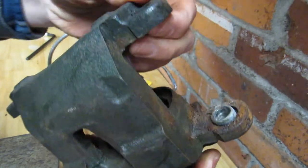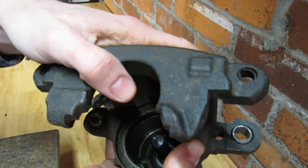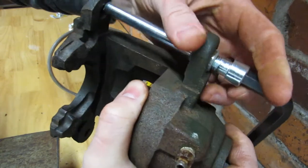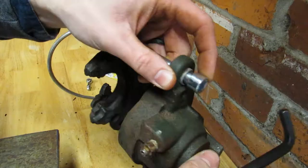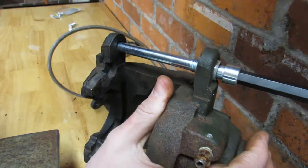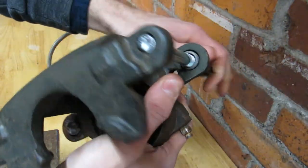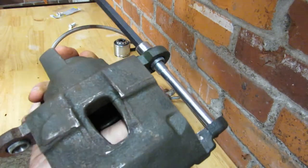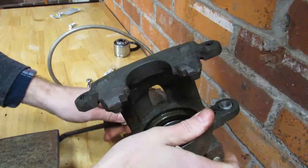The next thing I want to go over are the pins that actually hold these calipers in. These have given me a lot of grief on old cars that are original — not so much on cars that have been swapped. The pins slide in there and allow the caliper to float back and forth. These are just awful. I don't know who at GM thought using a 3/8 Allen on something later coined the GM metric caliper was a good idea, but here we are. If you think it's slightly ironic that they call this the GM metric caliper and it uses standard hardware, go ahead and like and subscribe.